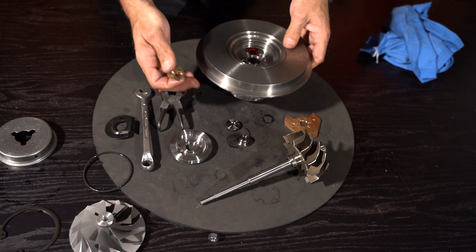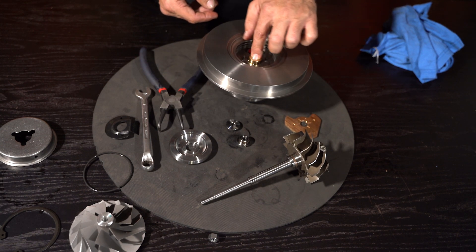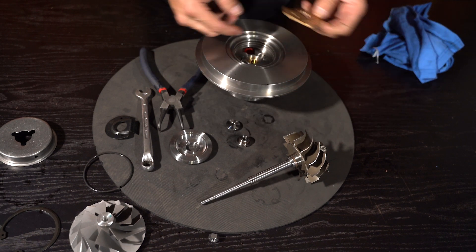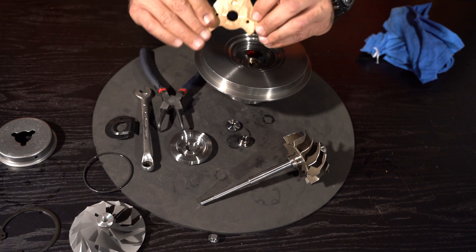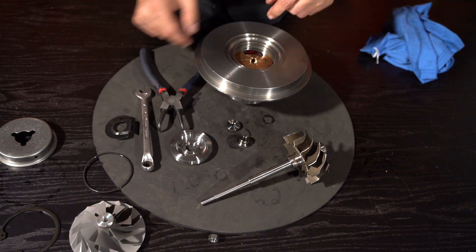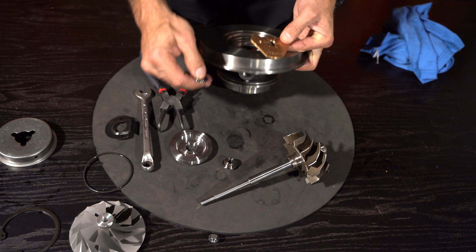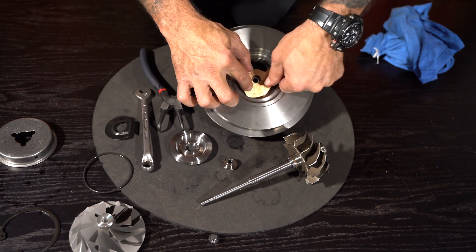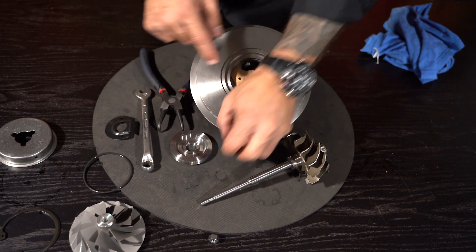Let's reassemble. The journal bearing goes in. I will need to put a new circlip inside — I don't have one right now since I damaged the other one taking it out. Thrust bearing goes in facing down so that the oil feed can mate. Don't forget the spacer. Thrust bearing into the locator pins so that the bearing itself can't turn and can't move during operation.